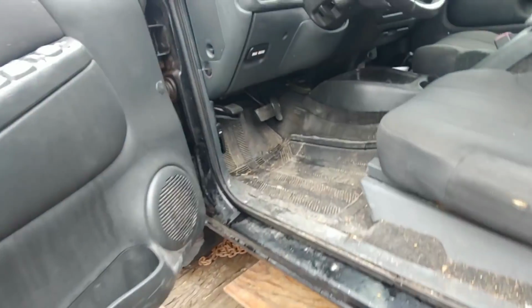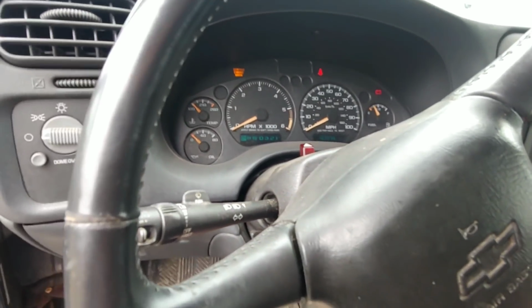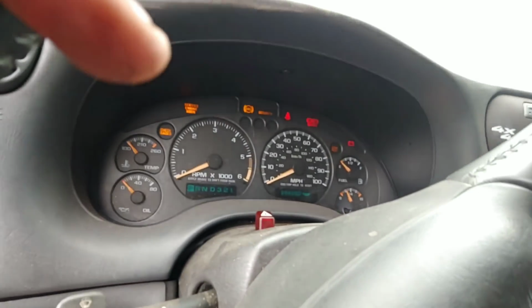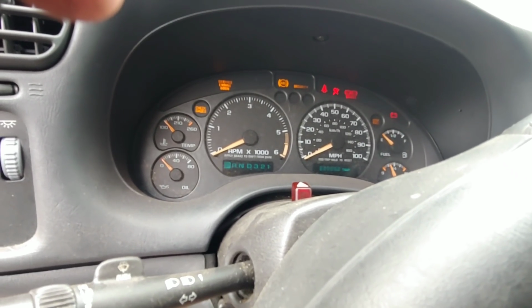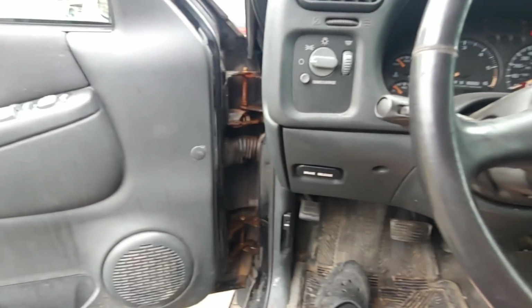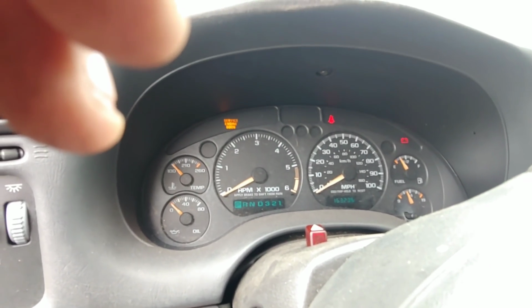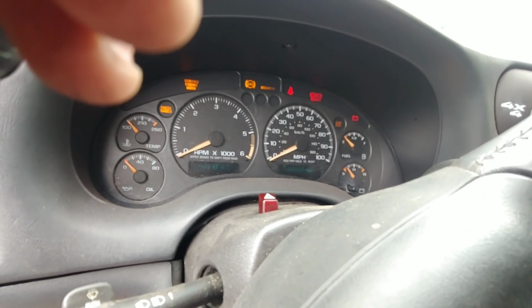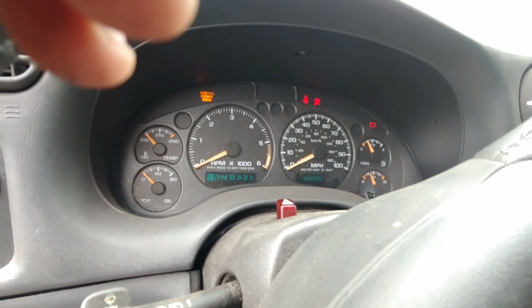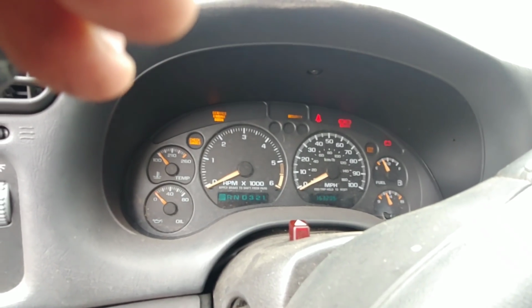Looks like somebody changed the rad hose recently. What do you think? Try it? Wait a minute. Yep. Hit it again. Something's sizzling here, like the wire's loose or something. I'm feeling for heat. Maybe it is locked up. Go ahead. Power. Hold it for a second. The battery's dropping really low. It's dropping down like 8 volts when I hold it.